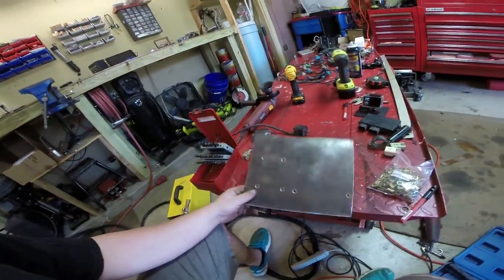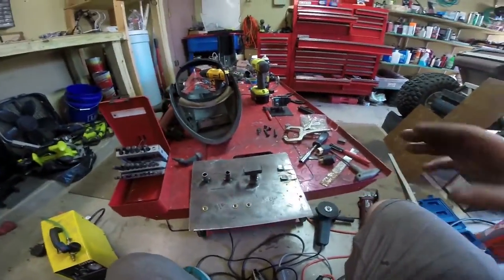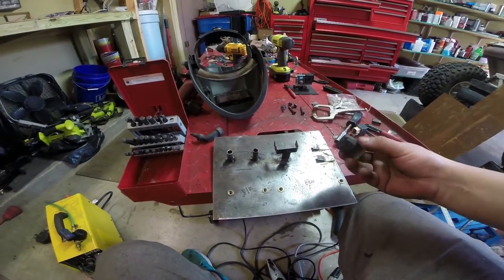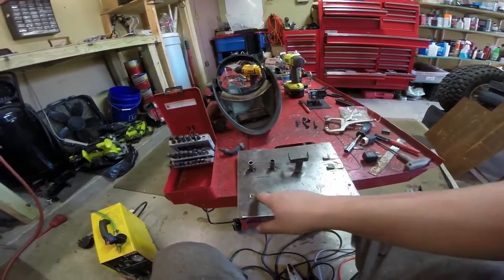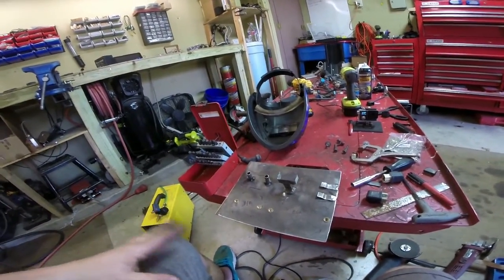That's what the rivnut panel looks like with all the rivnuts in it. That's what they look like from the back — you can see how they mushroom out, and that's what holds them in place. There's a channel on YouTube called Fabforms run by a guy named Kyle Voss — he always stresses details. Something like this is what really sets a project apart. We could have just randomly bolted it and threw it in a box, but instead we have these little sockets for the relays, welded towers for the coil, and rivnuts throughout. This panel bolts into the side of the golf cart and it's going to look like it was actually designed, and it gives us a nice ground plane for everything.